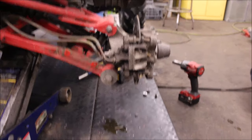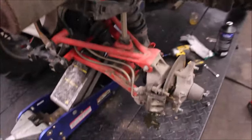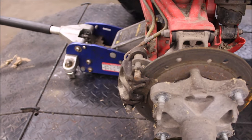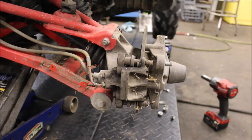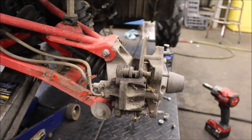I found problem number two: the rear brake caliper was leaking, and there are absolutely no brake pads left on here — it's metal to metal. So I'm going to be replacing that, and that should cure my problem. I've got fluid running through all the lines and it's pumping up good. It's filling up the foot pedal reservoir — there's a reservoir on the foot pedal you've got to fill up. When I pumped that up, it actually filled back into the master cylinder reservoir up on top. Once I take care of that leaking caliper, I should have the brakes all done nice and tight — no air leaks, no line stoppages.